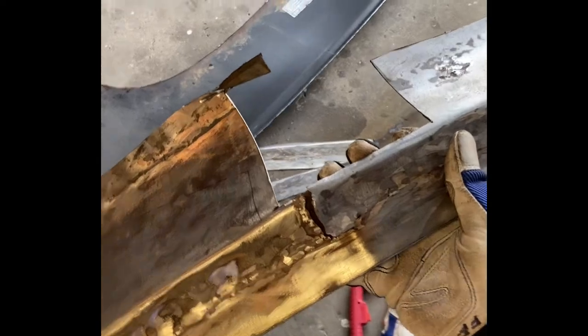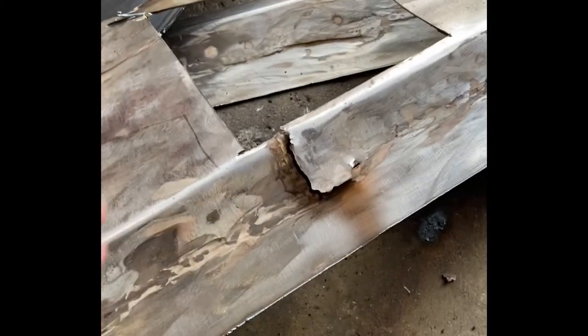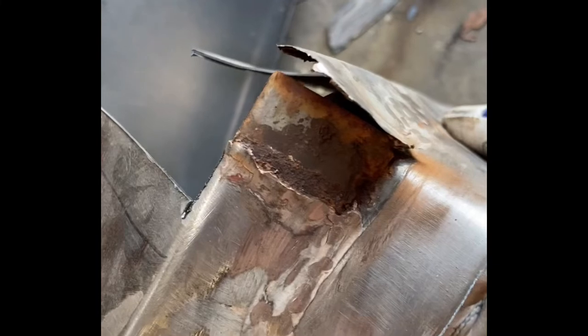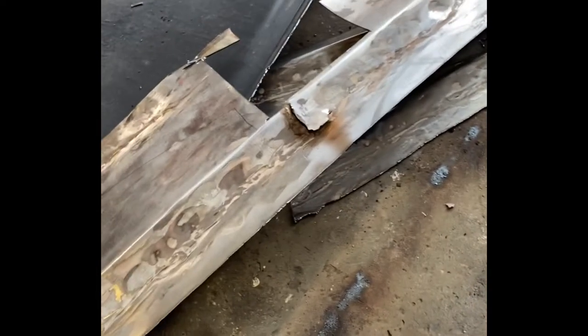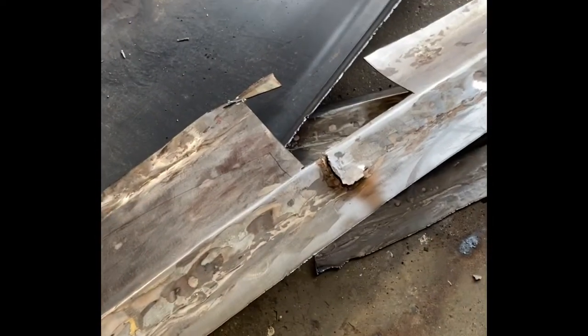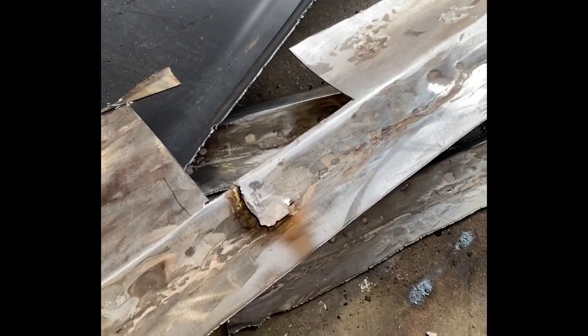I'm cutting up the remainder of this quarter panel off the Road Runner. For those trying to understand why a lap weld is not the best way to do this — a lap weld means you've got one piece of metal laid on top of the other like a sandwich, so you've got a layer of raw metal underneath. You get rust underneath there, and even if you cover it with some preventative coating or primer, eventually the weather and elements are going to get to it. That's why you want to ultimately aim to do a butt weld — two pieces of metal butted right up against each other. This way you have nothing hiding underneath, you get a nice clean surface, and you don't have any issues with your finish later on down the road.